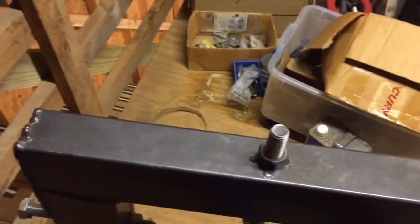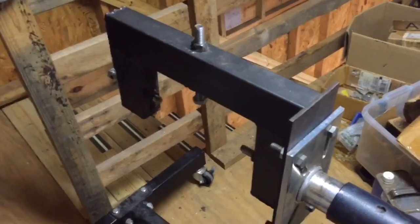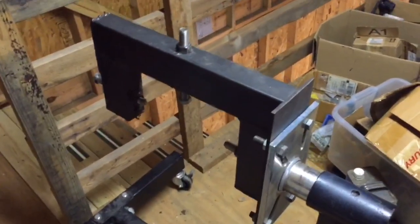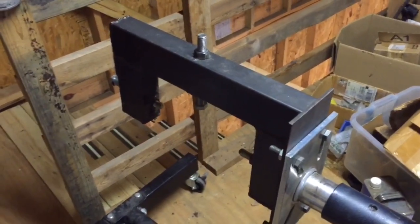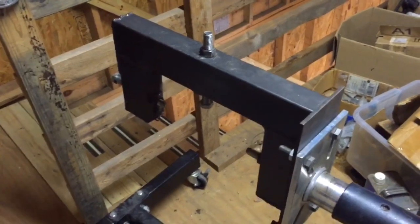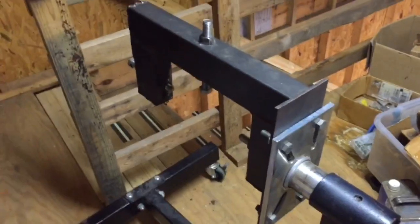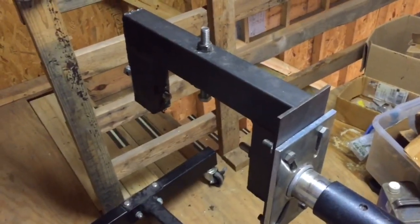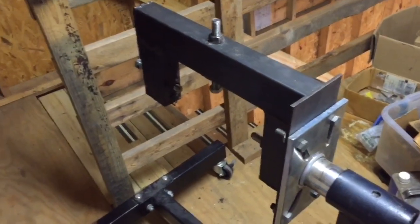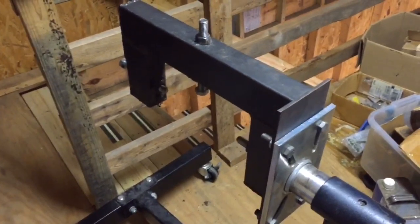When I did this, I had my engine on this engine stand — I only have one engine stand. So I made little brackets to go on the motor mount areas of the engine just to hold it, laid on the ground. But I wanted to make it in such a way that the bell housing area of the transmission would be clear so I could bolt it up or unbolt it off this engine stand. Here's a picture of it.